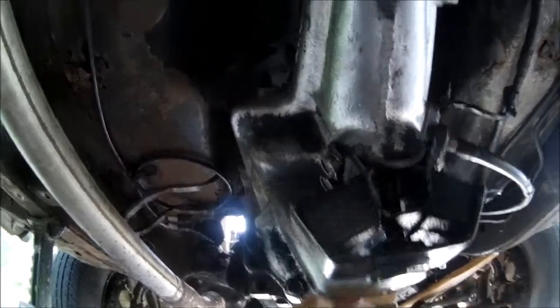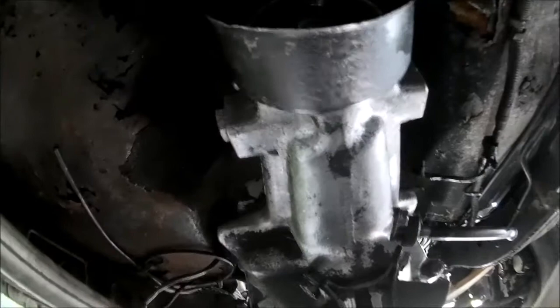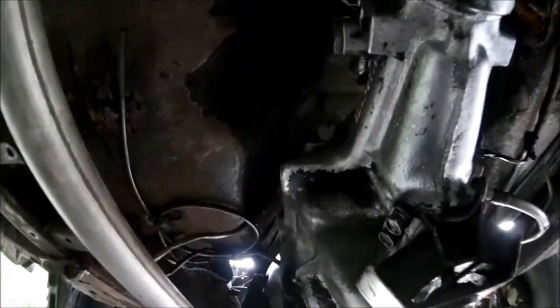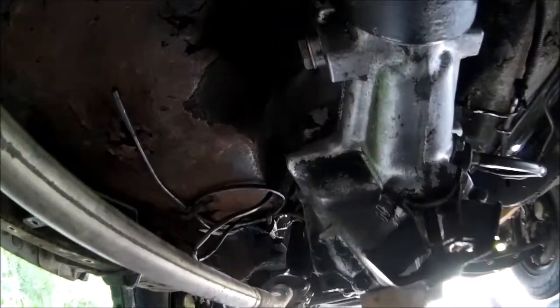But, so, I had to take the cross member back off, take the bolts out of the mount, put the jack back up, let it back down so I could access those top bolts, get everything loosened up, loosen up all the bolts I put in it, and then wiggle it, wiggle it, wiggle it some more until I finally got it flush all the way around. And I gotta tell you, that's a bear. Getting up and down, up and down, up and down. Check on top, check on the bottom, check over the left, check over the right. Because this jack's right in the middle, I can't just slide around under here and go look on that side and go look on this side. Not gonna work. But it's done. It's in.